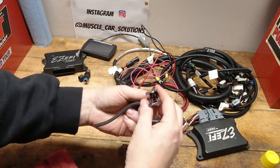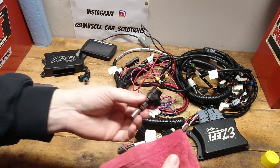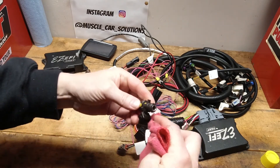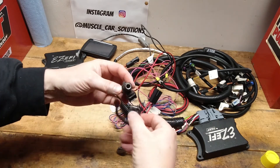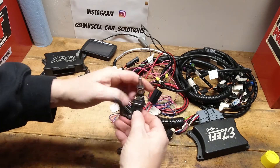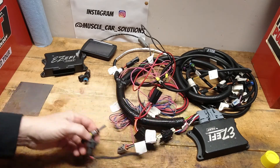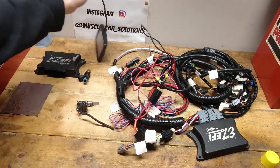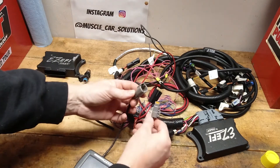This fuel injector is fairly unique where the seal is buried way down into the connection. In that case, go ahead and spray a little bit on a rag and wipe it on the body of it, so it will still allow the seal to slide onto the mating surface and connect positively. It's just a matter of keeping the connection clean and getting the spray directly onto the seal. If it's not a weather pack connection, don't use a silicone spray on it.